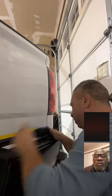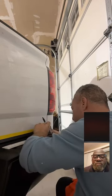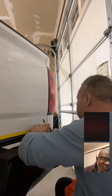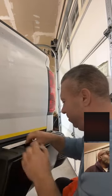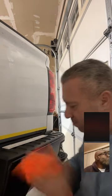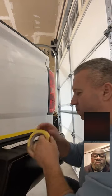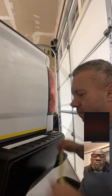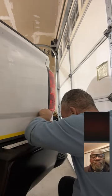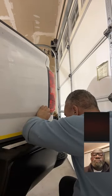If you know about the crow's feet that happen on Honda paint, a lot of cars do this, but Honda's famous for it. You see the cracks, the crow's feet, in the clear coat. You want to see one? I have one. That comes from the clear coat being too thick for its movement. In other words, the clear coat is too thick, and it actually shrinks when it splits. It splits into triangles, so you'll get these little lines, and it's breaking up basically.